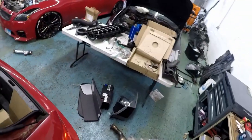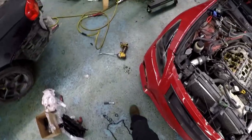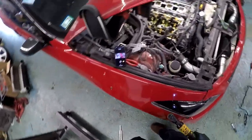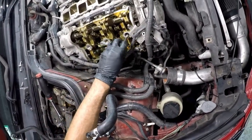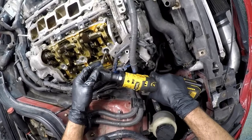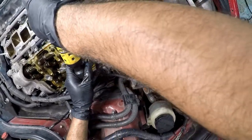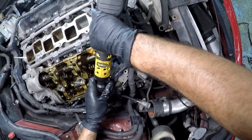I'm going to change the spark plugs too. Because on N54s, if you put stock ones on there and you start tuning it, sometimes they can't handle it. So that's why you put upgraded ones in. Yeah, I think I'll just play it safe and upgrade them, because I'm sure they're already old. Usually how many miles before you change them — like 15 to 20,000?